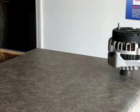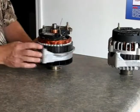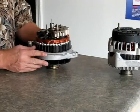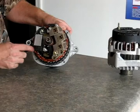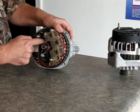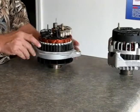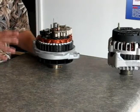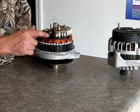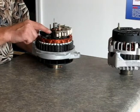When we talk about the rectifier, I want to show you some things. I've taken an alternator apart and put everything back together so you can see. How alternators work is you have your outside field, which is called the stator, and then you have your inside field, which is called the rotor. Your voltage regulator right here senses the state of charge of your battery — it's always monitoring your battery. When it needs power, the voltage regulator sends power into this brush holder. One brush is grounded, one brush is controlled by the voltage regulator.